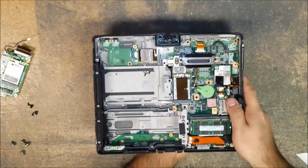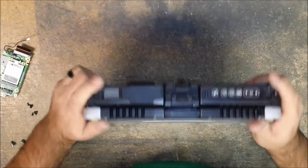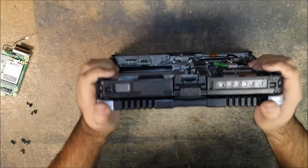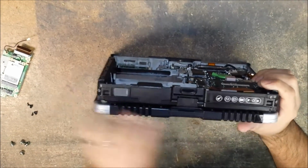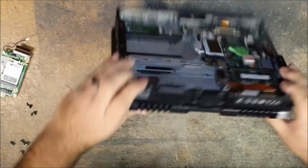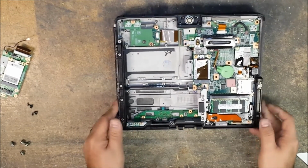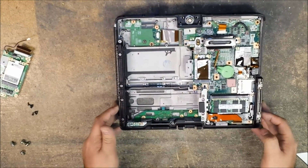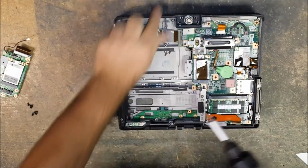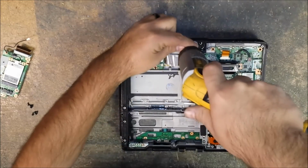So now you just align that nut there, and then all you have to do, just to get it perfectly aligned, is push on it until those little rubber bumpers fall into those circular holes there. And then to test, make sure that it did, wiggle it. It won't move that much. It'll move just a little bit, but it won't move much. So now that you have that perfectly aligned, you can go ahead and put those 4 screws back in that hold that assembly there.